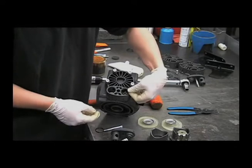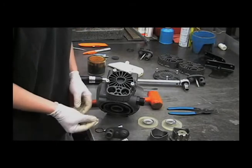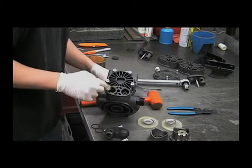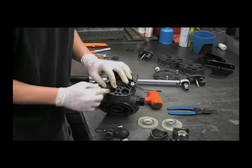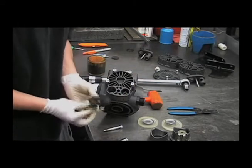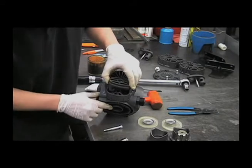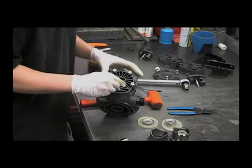There are two O-rings under this valve cap. You want to make sure that they're the correct ones — these are the smaller of the two that are similar size. It helps to put a little grease on the O-ring groove to help keep it in there. Push these in first before tightening the valve cap down. You want to meet this up so this side meets up with this valve and this longer side meets up with the one that's facing down into the crankcase. Careful not to move that O-ring so you don't pinch it. Take this longer bolt and tighten that down.